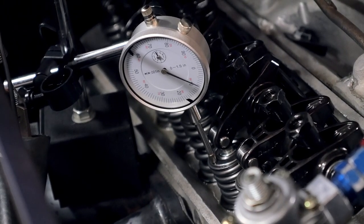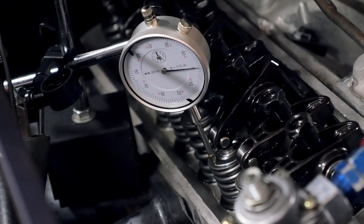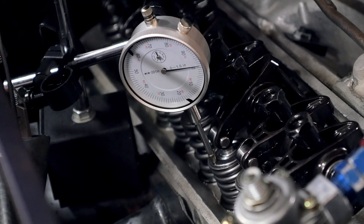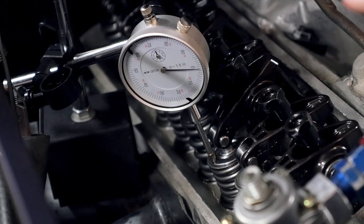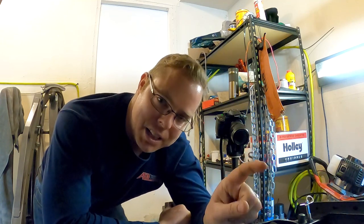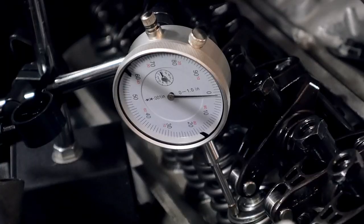Once you get to the top of the lift — right here, see — it's going to hover at zero and then go back in the other direction. See how it's perfectly at zero? Now it's on its way up. What you need to do is get to full lift on your cam, zero out the dial indicator as best you can, and when it comes all the way up you'll see it start counting — the small knob goes to one first, and the big knob moves a lot faster.